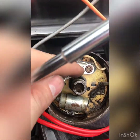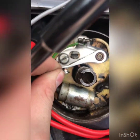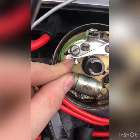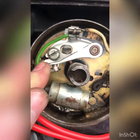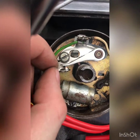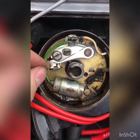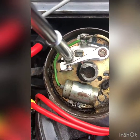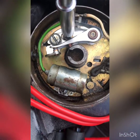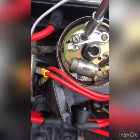Now I'm going to adjust it by altering these two screws until I have the correct gap in between them. I'm going to do this from memory, but it's best if you get a feeler gauge and your Haynes workshop manual - I'll put in the description the exact measurement you're supposed to have. You basically put the feeler gauge in there until there's a slight drag on it. I haven't got a feeler gauge on me so I'm going to do it by eye. If you twist these two screws down, that one fastens it down. You need two screwdrivers because you can adjust the gap that way.